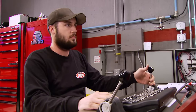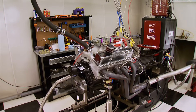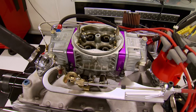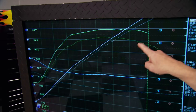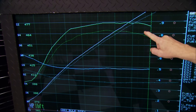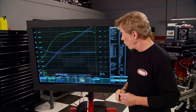The motor not only fired right up, it ran noticeably cooler and surprisingly required no tuning before our first full run. After giving the motor a total of 5 degrees more timing, we were making 12 foot-pounds of torque and almost 18 horsepower more than we made with gasoline — 477 over 459. Here's a graph that compares E85 with the solid lines to gasoline with the broken lines. Green is torque, white's horsepower, and notice how those power curves are identical except for the performance gains with E85. Down here is fuel consumption, and as expected, we consumed about 24% more with our E85.